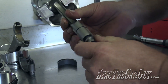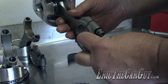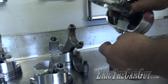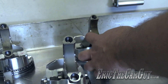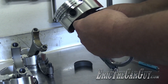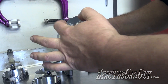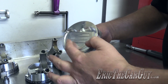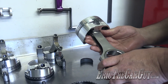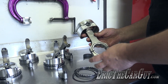On the connecting rod you'll notice a small chamfer at the outer edge here, and a large chamfer on the other side. That large chamfer has to go against the cheek of the crankshaft. So when this is in the engine — say this is cylinder number five — it's going to go to the back. That's how you know which way these go in. For cylinder number one, the chamfer goes to the front, the valve notches go up to the top, and of course we have a slight dish for the boost application — we want lower compression with boost to avoid the extreme heat situation.